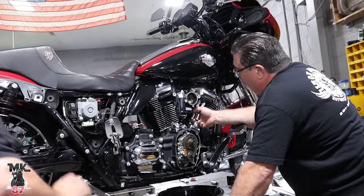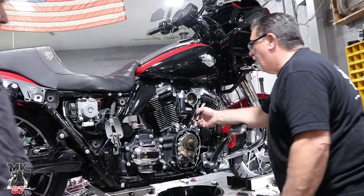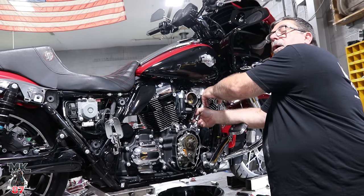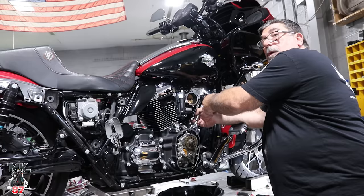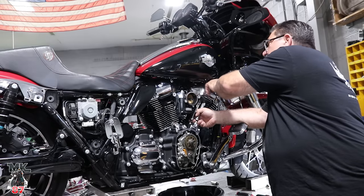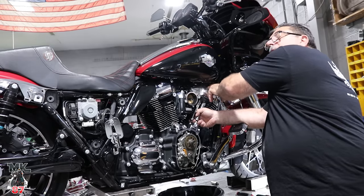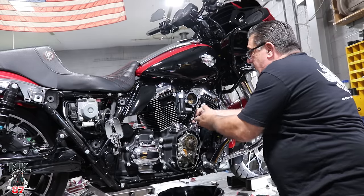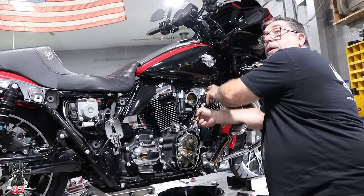Right there, you're good. So what's the reason why you're turning the tire in the back? Because with the push rods extended up, when you do cut the push rod, the valves will snap down. And you don't want to do that because you might loosen the keepers off the top of the springs. Gotcha. So what you want to do is cut them while there's no load on the valves.